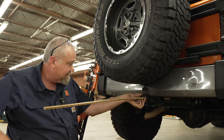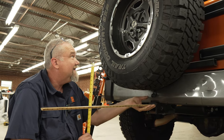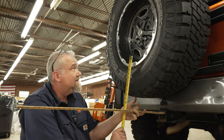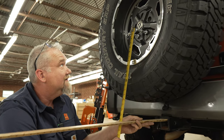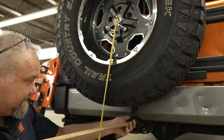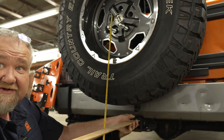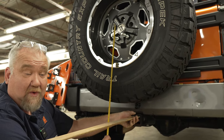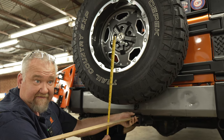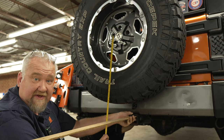You can stick a flat surface just like we have here. From the very middle of that tire — and some of you have cameras so you can put it right where that camera is — measure from the very middle of that tire to the top of that hitch. If it's less than 25 inches, you're good. If it's more, you're going to need our foot extensions, which we have, and they'll be online by the time this video comes out.